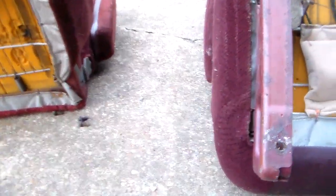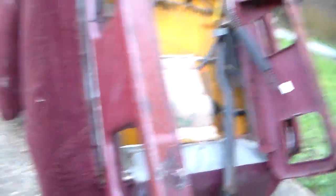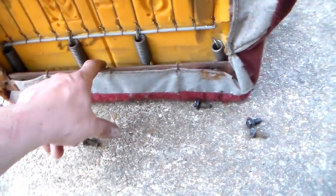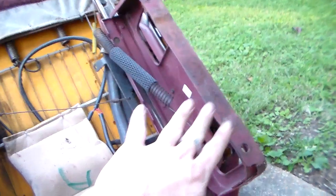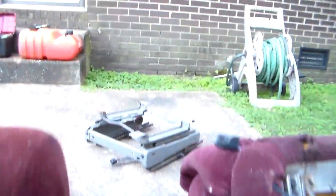There's been a lot of questions on forums about how to change the seats around, so let's get into that. First off, we've got a little bit of terminology to talk about. You have the seat itself — this seat has a frame in it, a metal seat frame. You can see the edges of it here; that's where the upholstery attaches. That's what keeps the seat together and serves as the mounting points for the riser. This is the riser here — this metal part that bolts to the floor. This is not all one piece that comes off; you can see that assembly over there.